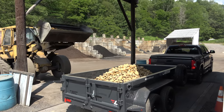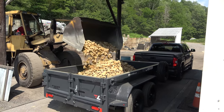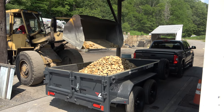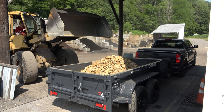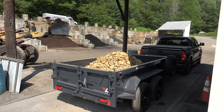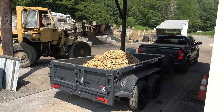As you can see, this isn't even filling up the trailer as much as you might think. The payload on this particular trailer is roughly 2.3 tons, so I just got two tons in this case — I could fit a little bit more rock. But I don't want to overload it; I want to make sure that I'm within the towing capacity of the truck as well as the weight capacity of the trailer.